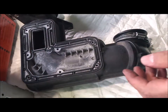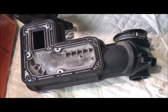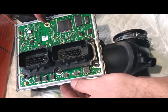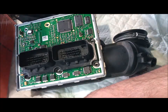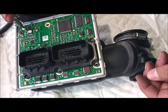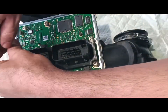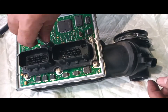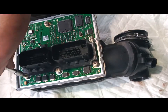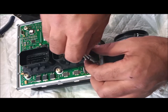We can start putting it back carefully and gently. Make sure that the holes coincide and start putting the screws in a star shape. Also make sure everything is clean. The torque is 10 — you can torque it by hand. Just make sure everything is tight by finger and that will be enough.